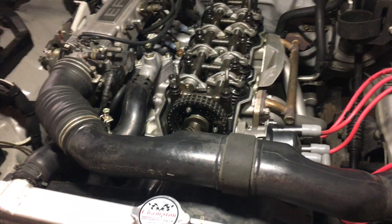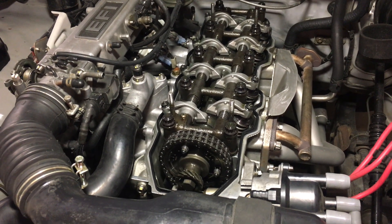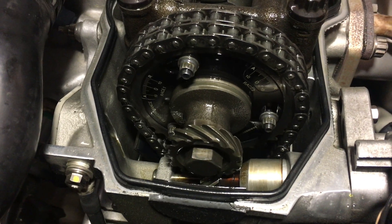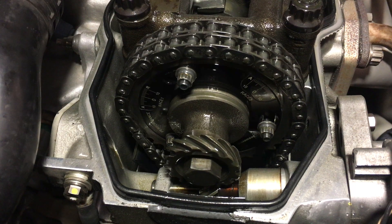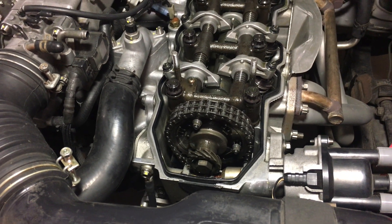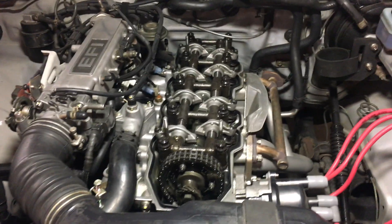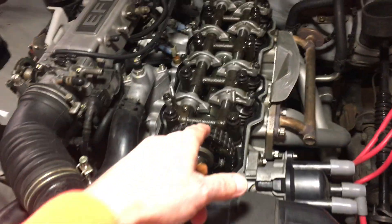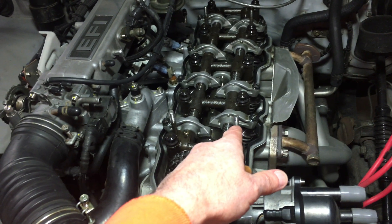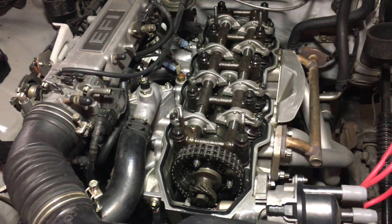Just a quick little video while I'm working on my truck here. You can see I've got the valve cover off. The reason for this was I wanted to adjust the valves — I noticed that the engine had a little bit of a weird, more-than-normal ticking noise. I wanted to double-check that everything was still okay with my adjustable timing gear, which looks okay, and check the tension on the timing chain. I also put a bore scope down to confirm that my timing chain tensioner was still free-moving and functional, which it was. So while I had the valve cover off, I decided I would adjust the valves. The number one cylinder's exhaust and intake were pretty far out — around 15 thousandths instead of the 12 or so that the factory recommends. I think that might have been where my ticking was coming from.